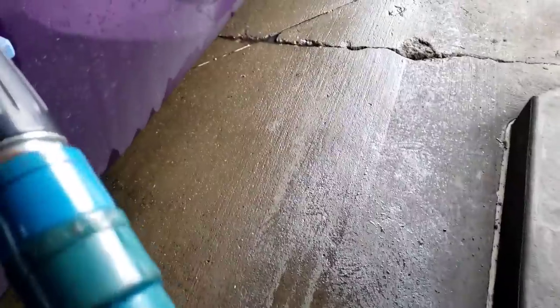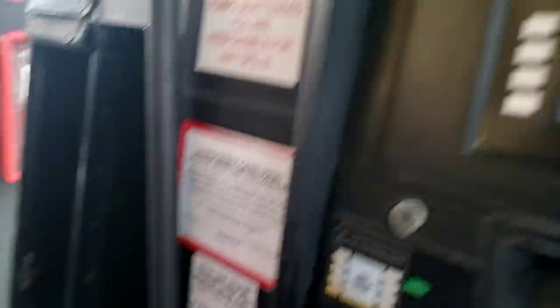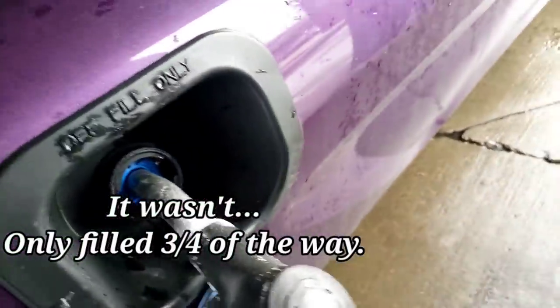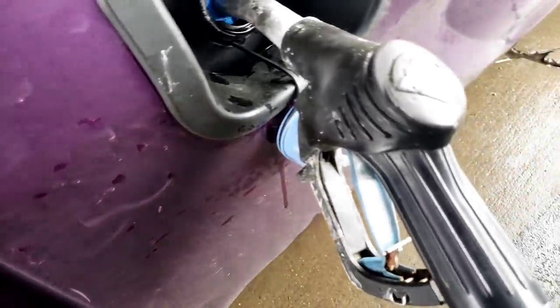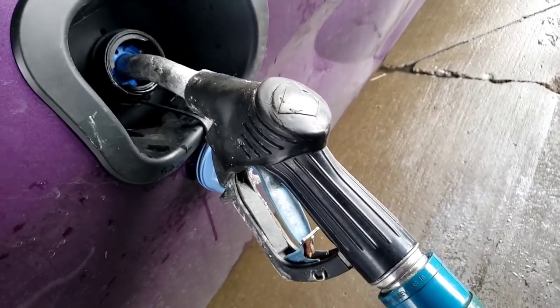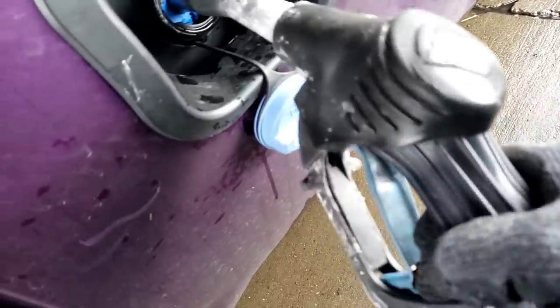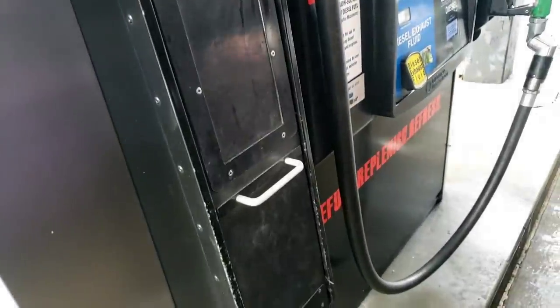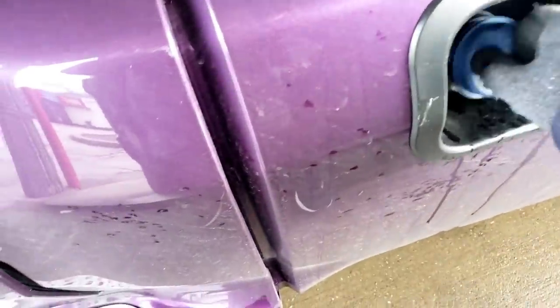Usually what I do is I pull this out and I step on it — not enough to make it stop, not enough to squeeze it out. We got five gallons, it might be full. These things don't top off very well — it's such a tough fit right there. Some issues that happen: it'll keep clicking off sometimes, other times it'll go really really slow, and sometimes you get lucky and it works just fine. This stuff freezes up a little easier, which is why it's in this protection. In high-freeze areas it'll actually have insulation all around it as well, because it freezes up a lot easier than the diesel does.